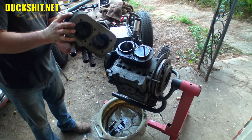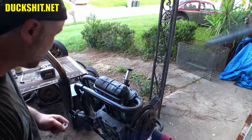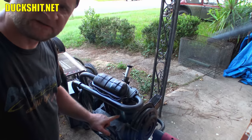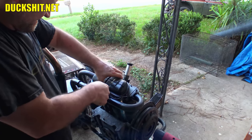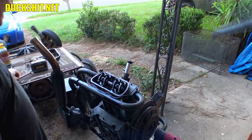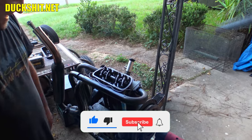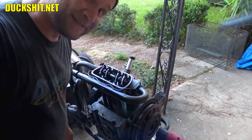More things to fix — this time I'm going to do it properly. Welcome back everybody to my noisy neighborhood. Today we're going to pull the head off — at least the one with that pushrod tube — because I'm not happy with it. It feels dirty. We're going to get that tube out of there and replace it with a proper Volkswagen OEM part. While this thing was sitting upside down it actually did drip just a little bit. We're going to fix this today, put a proper pushrod tube on there, and also measure our displacement at the same time.